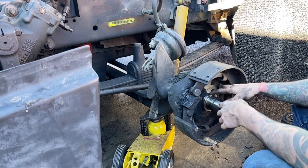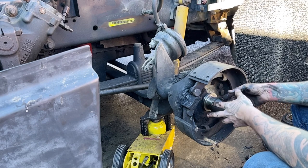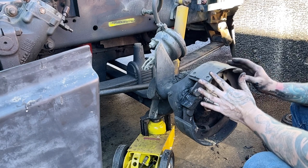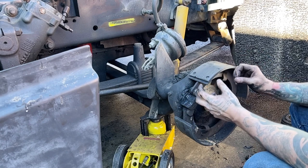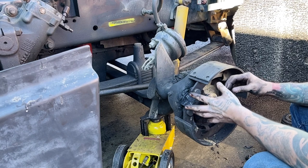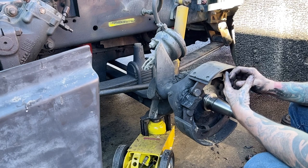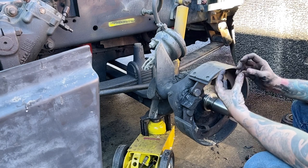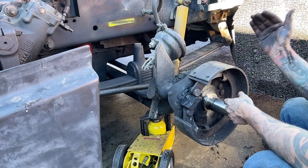Now, with drum brakes, you'll always have brake fade. You'll feel it kind of immediately. You've got your truck, all brakes are adjusted. You get out there and you touch the pedal, and man, that thing's reactive. By the time you've stopped two or three times in town from 30, 40 miles an hour, you can feel it in your foot if you're observant. You have less brake authority than you did. And imagine that coming down a mountain.